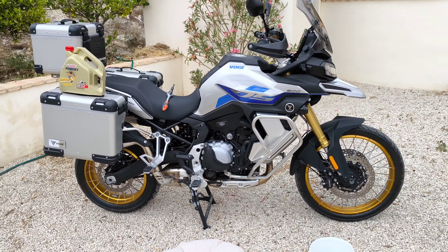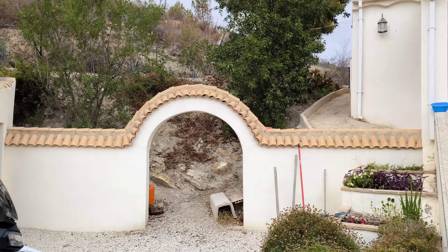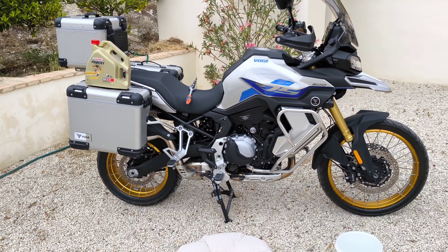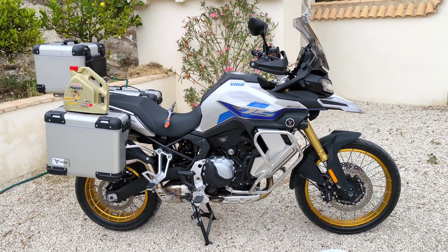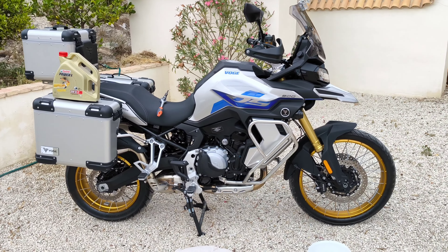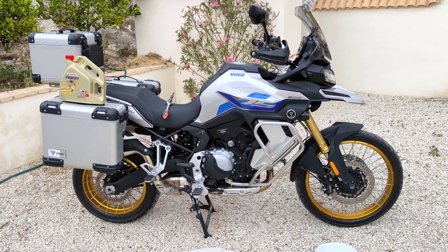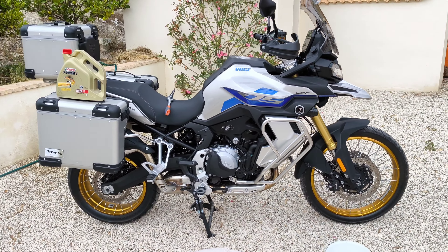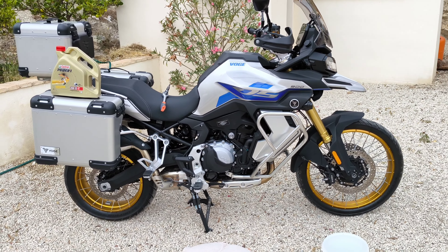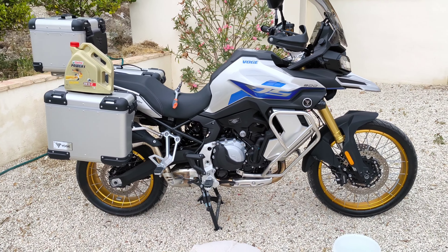The main reason I'm doing it is the climate in this region where I live. Today it's a pretty overcast day, only about 23 degrees, which is quite cool for this time of year. But the last few days we get up into the mid-30s centigrade, and often from June onwards we can hit 42 or 43. So in the manual for the DSX 900, the recommendation is different oil grades — it recommends that if you're going over 30 degrees and up to 50 degrees centigrade, to use a 20W50 grade oil.